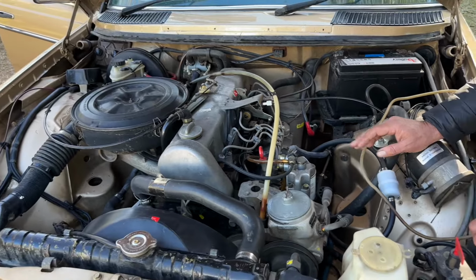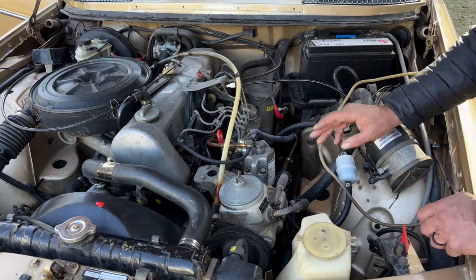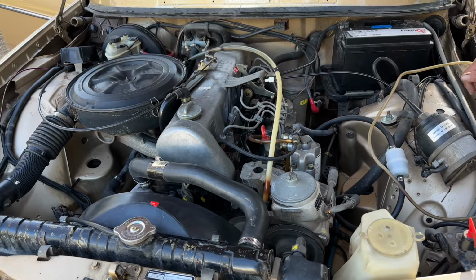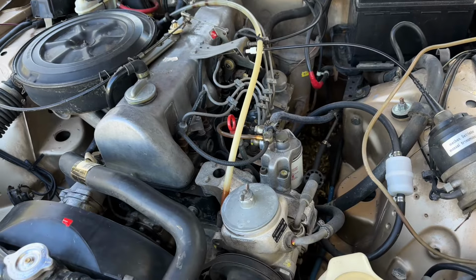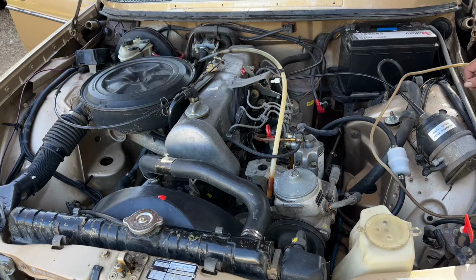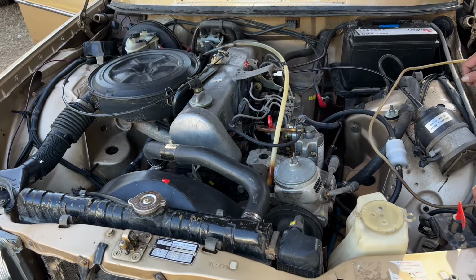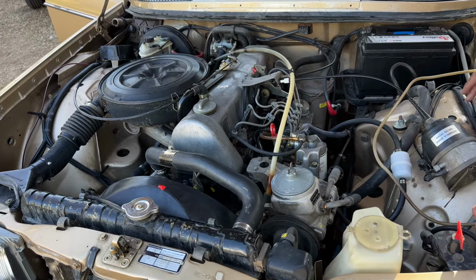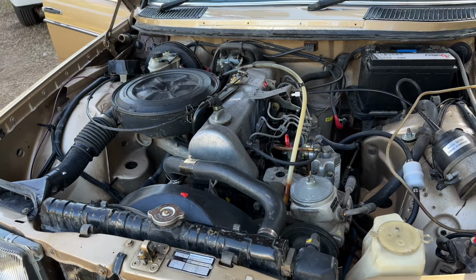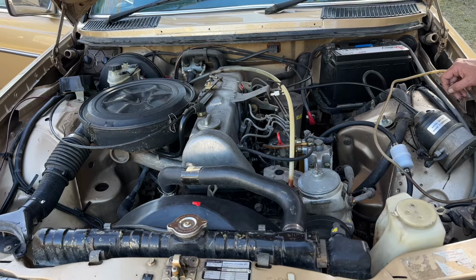In all the time I've been driving these cars, and it's been a lot of time, the issues that I've had with them are generally vacuum pump related. The diaphragms in the vacuum pump eventually go, and you have shut off issues, as you can see in another video that I've done on the channel where I speak about that. So you do have those sort of issues, but they're easily resolved and they're not frequent. I mean, the cars are 40 years old, so now is the time that it possibly needs to be replaced. But we have diaphragms in stock, for example, so it's no big deal. And beyond that, it's just regular servicing, you know, nothing else.